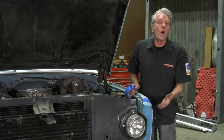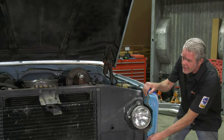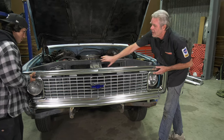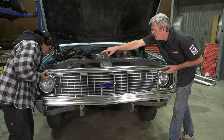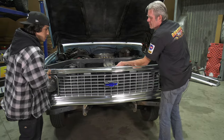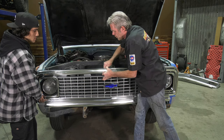This is primer so I don't have to worry about paint, but make sure you've got tape wherever you're going to make contact, all the way down to the bottom. Once the paint is protected, I'm going to spread the fenders out a little bit to make it easier for the grill to go in. When we're getting the grill in, he'll get his side started and up in there good. Got to make sure this piece right here is up on top. Now I can get my side started. I'll get a bolt in the top right here so I don't have to worry about the grill falling, and then work on the rest of my bolts.